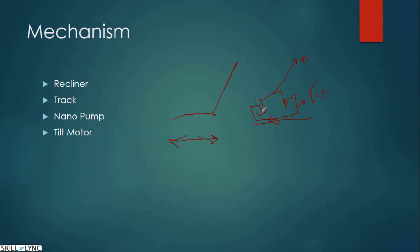The male profile will move against the female profile, and this is why we get forward and rearward movement. In a cross-sectional view, the female profile will have teeth or holes, and the male profile will have an opening. When there is a lever in the front — as in a car — and we pull it up, these teeth get disengaged and the male profile can go forward and rearward. When we push it down, it engages again and fixes the seat.